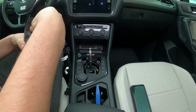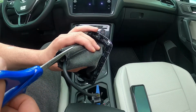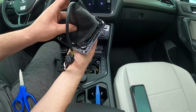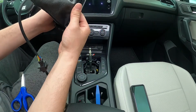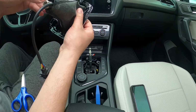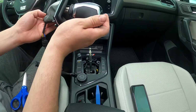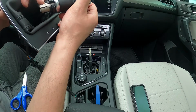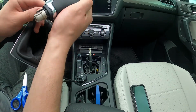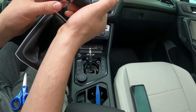Alright, so what I just discovered through watching the install video is you're going to have to cut your stock boot just a smidge. So I'm guessing we'll try that for now, because you don't want to cut too much at one time and then be in an uh-oh situation. So just do a little bit at a time. You want to try and get all that through there, or as much as you can, which, okay, that actually fits up in there like so. So you just make sure this piece right here is all the way clipped into the bottom of the shifter there, and that basically just holds everything together, I imagine.